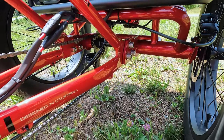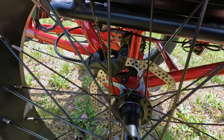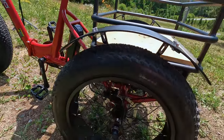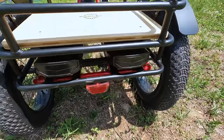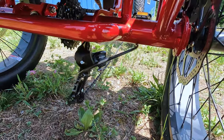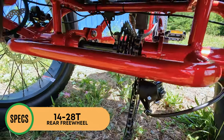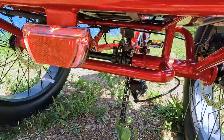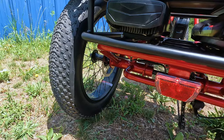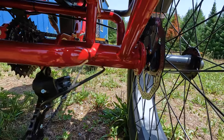Here's a look at the rear axle with the 20 by 4-inch Kenda tire, and one of the two Zoom hydraulic disc brakes tucked back there — both rear wheels have Zoom hydraulic disc brakes running off a single lever in the cockpit. The fender provides some splash protection. There are two rear batteries, and a rear brake light. The drivetrain includes a Shimano Tourney rear derailleur and a 14 to 28-tooth rear freewheel. Since there's no differential, all pedaling power goes to the right rear wheel, and the left rear wheel free-spins until you hit the brakes. The motor is in the front. There's also a Zoom hydraulic disc brake on the right rear wheel, giving you dual hydraulic rear brakes.